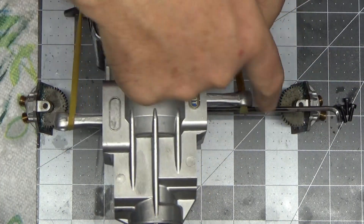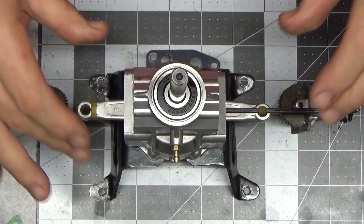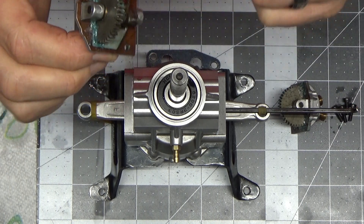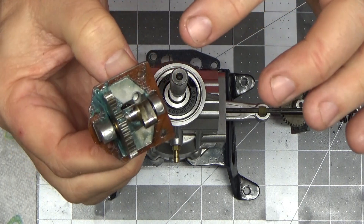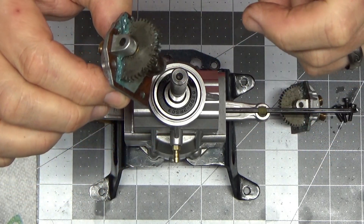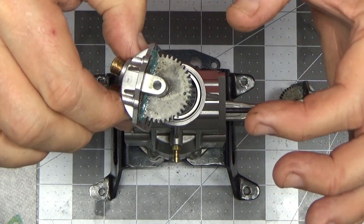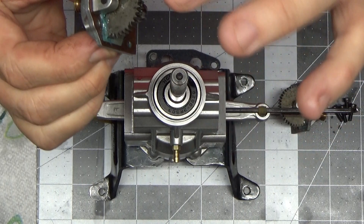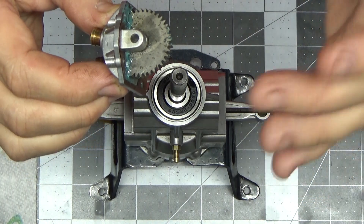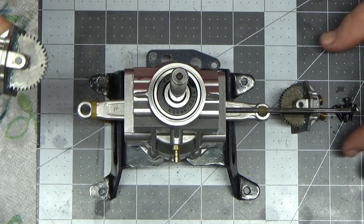I've got a little rubber band here to fixture this thing so it doesn't move much at all. These larger engines have the mushroomed out cam followers, so you can't use a tool to stick in there and find your position. You have to have your cam followers in there and then carefully place this on without moving the timing gear. I use a little bit of automotive brake grease, slather it on both sides — it forms enough tension to actually hold that in place.